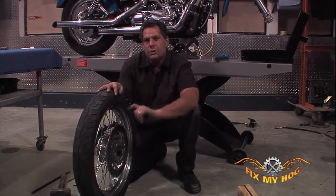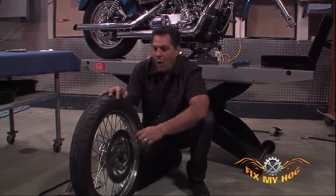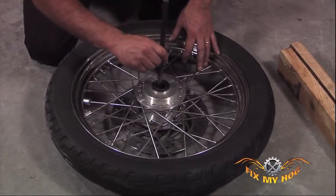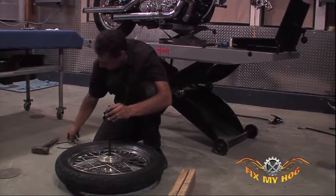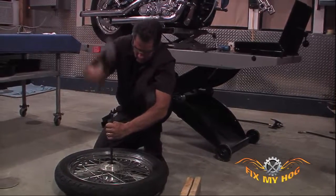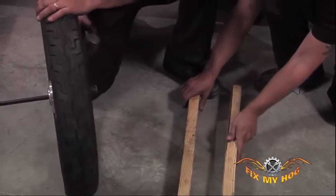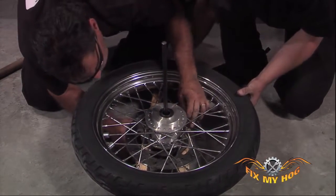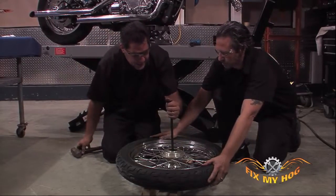If you're able to get one of the two bearings out, you can remove the center spacer and then work through the hub of the wheel to drive the other frozen bearing out from the opposite side of the wheel. Again, keep your blocks of wood as close to the center as you can. Try not to cause any excess pressure on the rotor assembly itself.